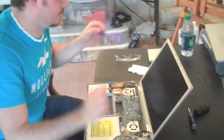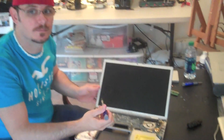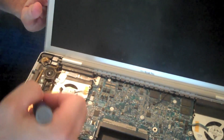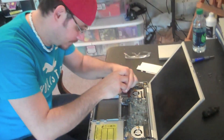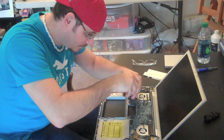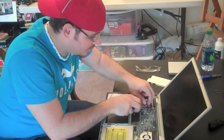Be very careful when you lift up all of these little connectors. You have different ones for different things — LCDs and all. Not all of them have to come out. Most of the screws on the motherboard will be Torx, but I believe two are going to be Phillips.